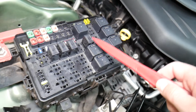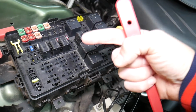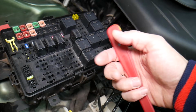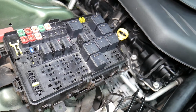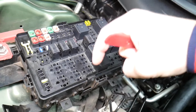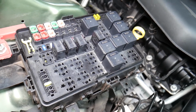But when disconnecting the car battery, guys, a common mistake people make, it's important to know which battery terminal you disconnect and reconnect first. If you do it the wrong way, you can burn electronic modules. How do we know about that? We burned before the traction control module on a BMW that cost us $2,000, guys. So we'll put a link in the description of the video below on which battery terminal to disconnect first. Check it out for your convenience.